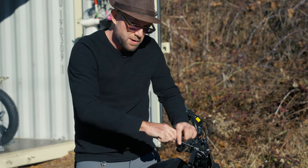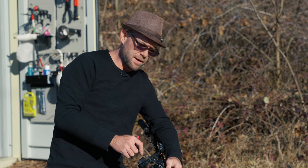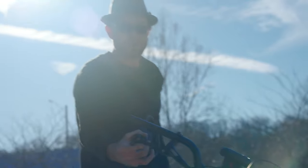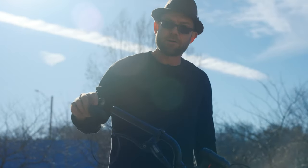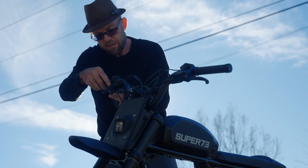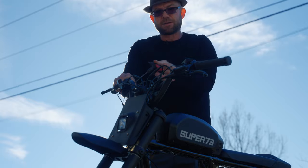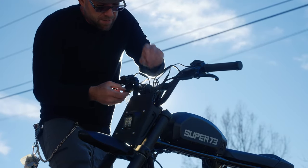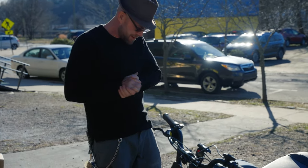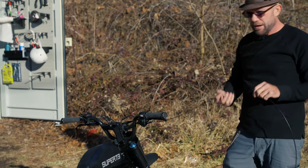Locking grip off, brake lever loosened. There doesn't seem to be enough cable to take the brake lever all the way off, so I'm going to take the backing off here so we can just slide the throttle off. Starting with the brake lever, then we'll do the shift lever, the throttle, then the handle grip. It's always trade-offs on bikes — you want to put something else on, something else has to move. Connect this throttle wire back. Hopefully the cable housing will fit on the cable still. Now with the cable housing in the shift lever installed, we've got to figure out the routing.